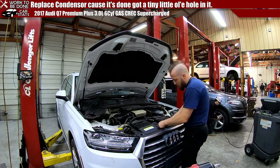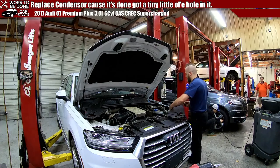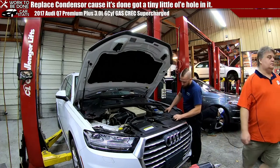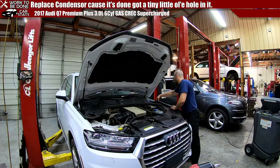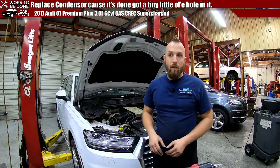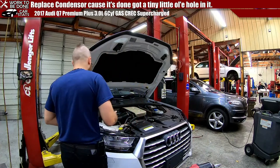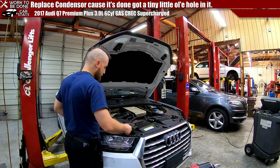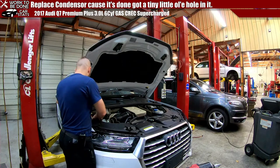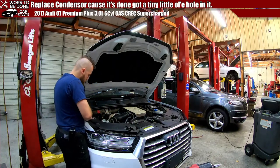I was just like, can I help you guys? Because they were trying to jump it off, and it wasn't starting, and so I happened to have my scanner with me, so I scanned it and looked for a crank sensor code, or any codes really, but then it would still not start. I pulled the fuel line off, it had fuel. And I hooked up my scanner, I spun it over, and I looked at the data, and we are getting no crank signal, so it doesn't matter how many times you try and jumpstart this, it's not going to start until it sees a crank signal. So you kind of just need to get it towed to a shop. And they're like, well, thanks for helping. No problem. Glad I could do what I could do. Sorry I couldn't do more. And they're like, well, at least you stopped. True.